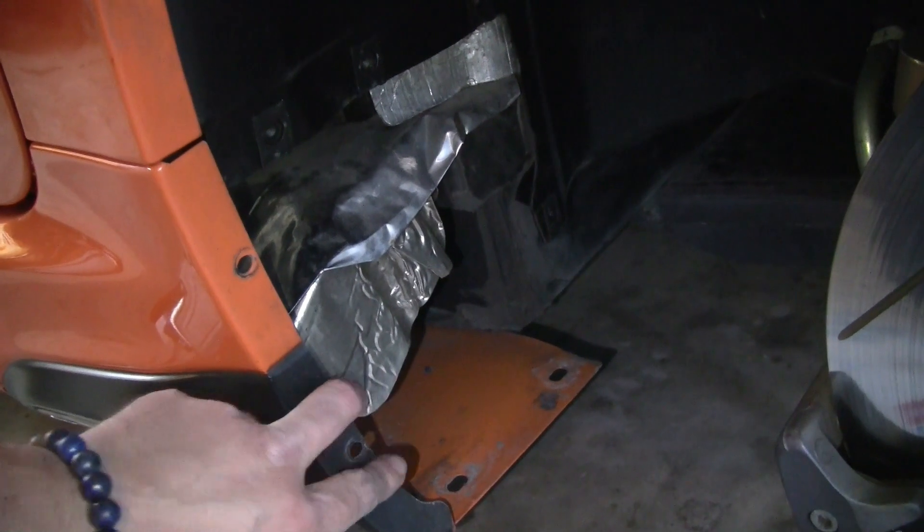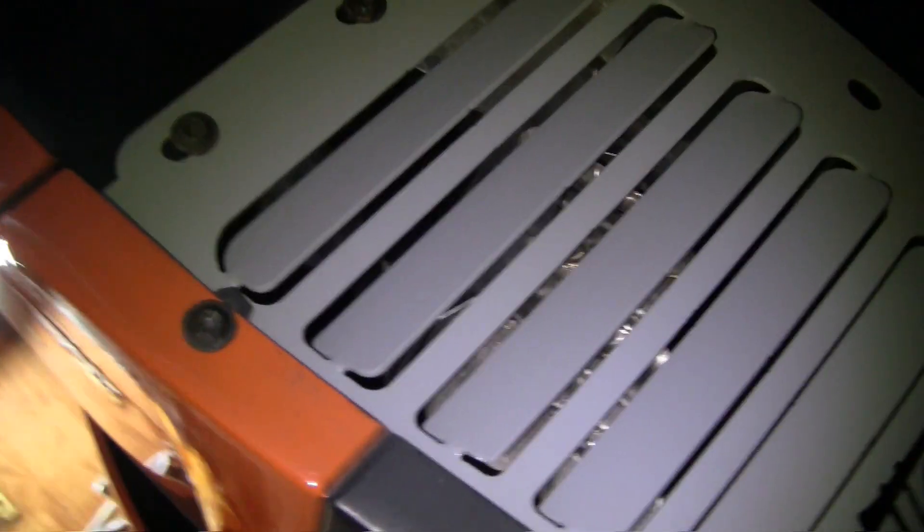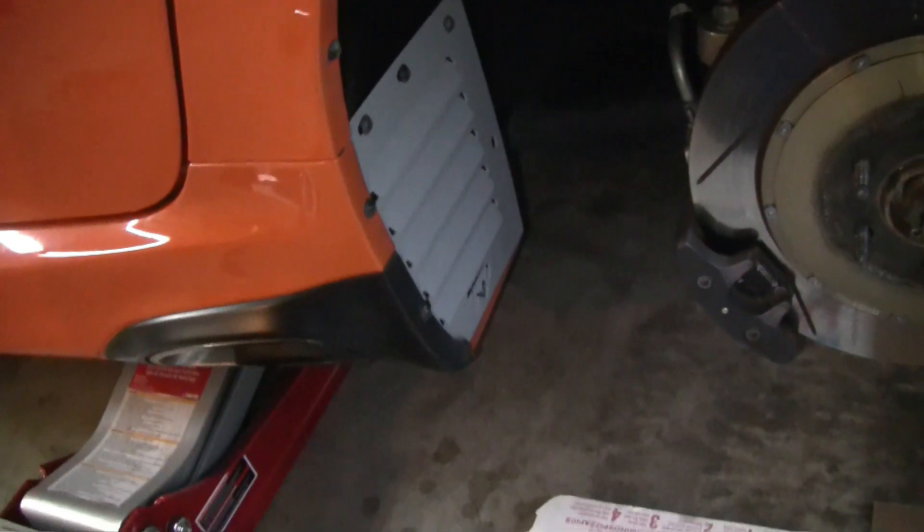Let's see how this looks when we put it back together. Here is the TKO plate installed. A couple little bits of feedback: the fender liner is curved and the plate is flat, so you can see there's a little gap because it's not a flush three-bolt surface. These two fasteners have to kind of pull the shield forward, so you end up with some extra material and a curl in there to get everything else tight. This one here isn't happening - with the shield bolted on the underside with those oddball 3/8 bolts, there's no extra material to pull this one in, so there's a substantial gap. But it's in there really solid, it's not going anywhere, and you can look right up inside and see the heat shielding with a big air gap on top. This should work pretty darn well.